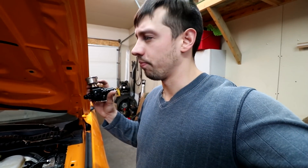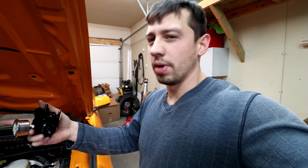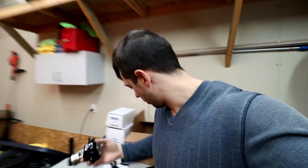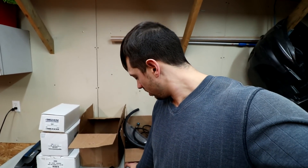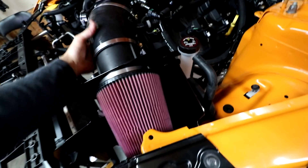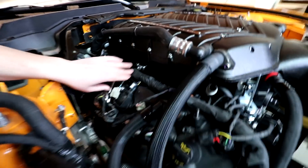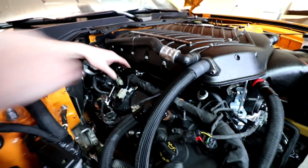It's all dash eight fittings. There's a mechanical pump over there, and because there's two fuel systems, you actually have to mount two regulators, which is kind of annoying. There's gonna be lines everywhere — it's gonna be a busy bay. It already is a busy bay. And this is like the biggest air inlet thing I've ever seen in my life. So that's essentially where the rail's gonna be sitting.